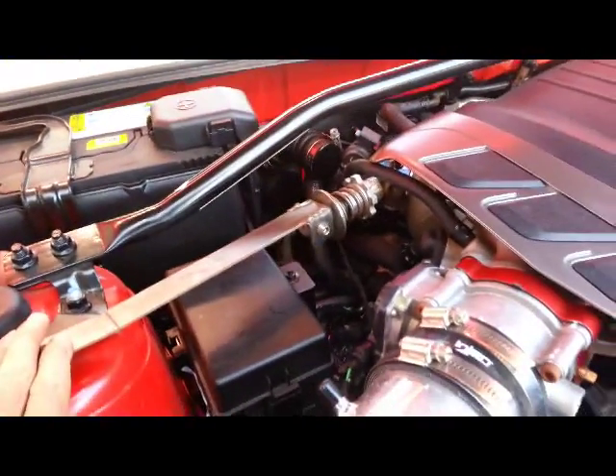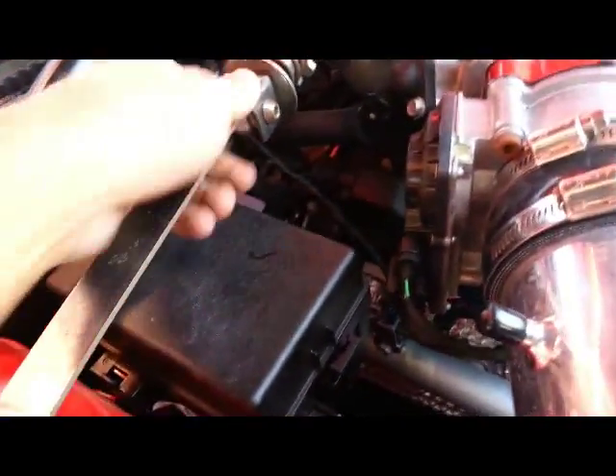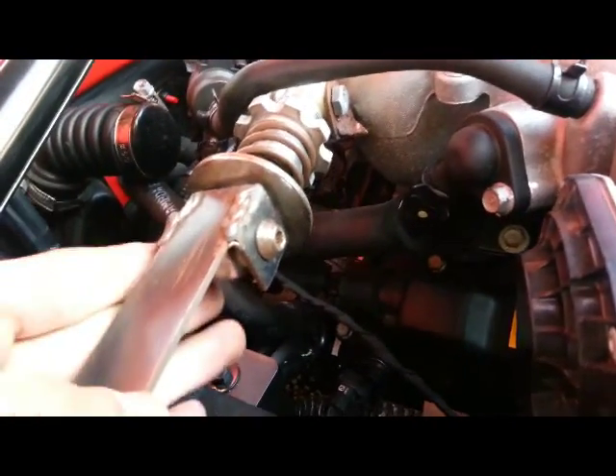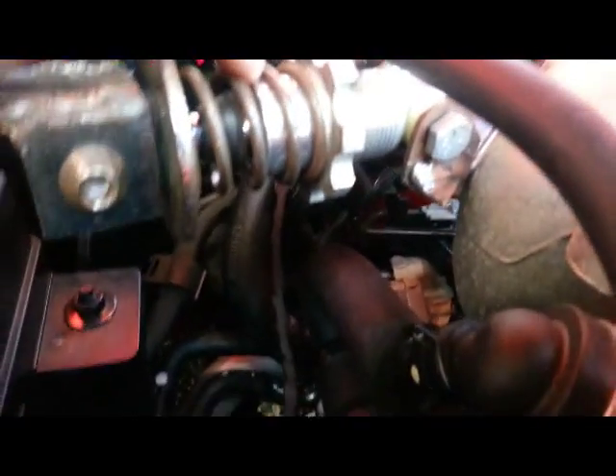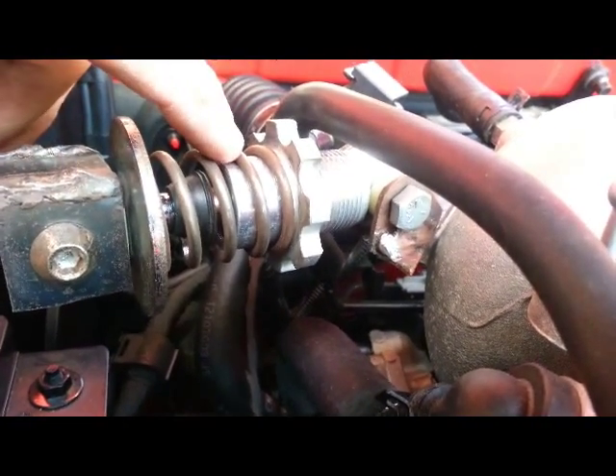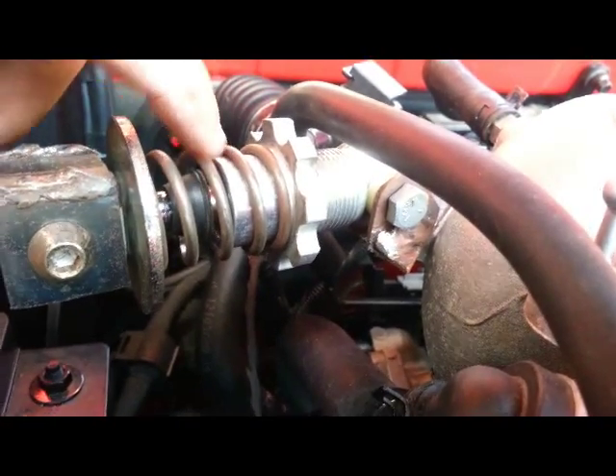This is a quick video about the torque dampener I installed. Basically, I got a hole in here to mount this side — just a straight bar — and then welded two pieces coming straight down so I can put this bolt through. This is just a shock absorber from some go-kart or scooter I had as a kid, found it in the garage, and then welded it up.